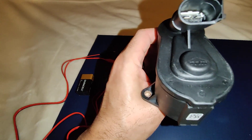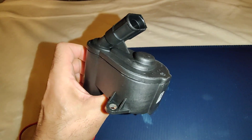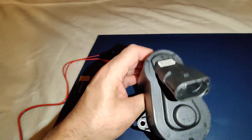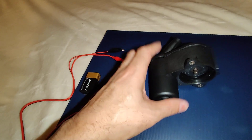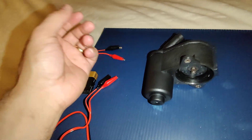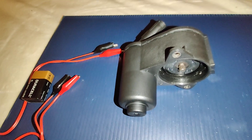This is only for the electronic parking brake — those are the two pins in there. This motor is by TRW and is for an Audi vehicle, but most of these motors work in the same way — that's how you wind them back. Very easy. Or if you have the scan tool you can do it with the scan tool, but a lot of people don't have one or don't know how, so you can just do it this simple way. Like, share, subscribe, and God bless guys — take care.